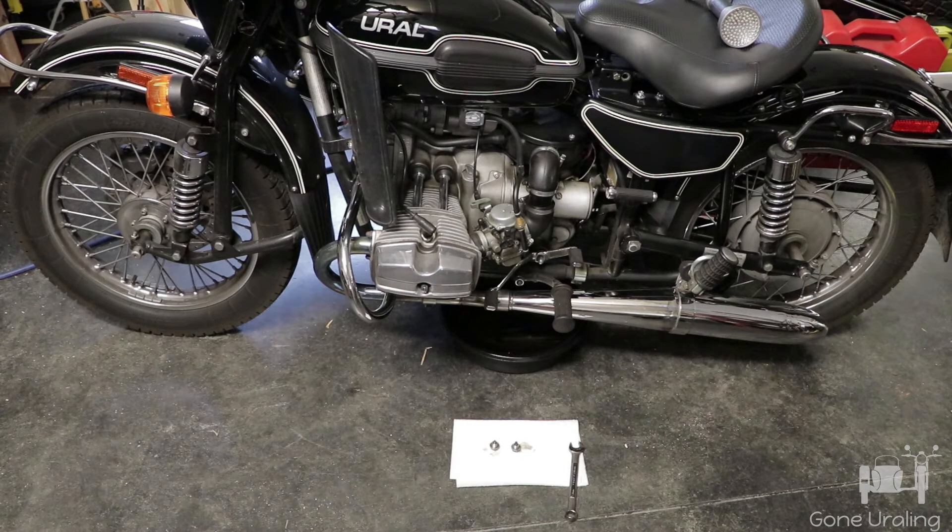We're going to be taking a longer trip and I don't want the maintenance interval to fall in the middle of that trip. The other reason is that after about 5,000 miles I felt like it was time to pull the plug and see what kind of swarf had built up. The engine oil was last changed roughly 5,000 kilometers ago when I converted over to the spin-on oil filter, and the transmission was changed right after I got it, so it's had the full roughly 8,000 kilometers on that change.